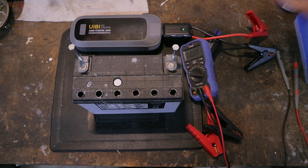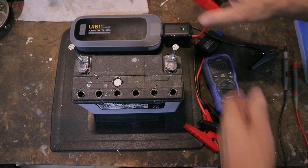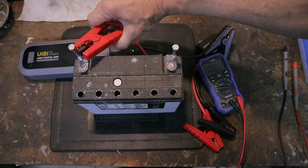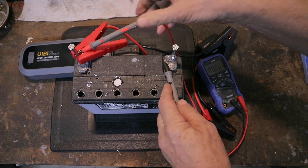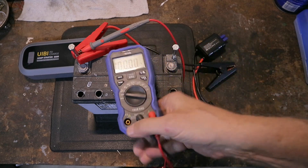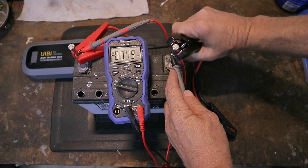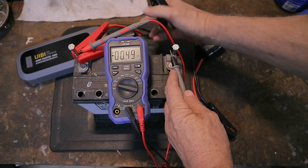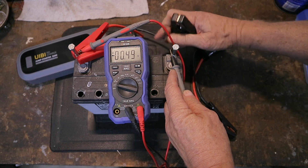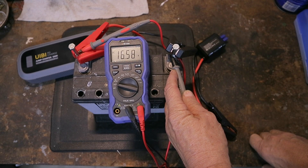It's flashing back and forth red and yellow - that tells us it's ready to go. I'm going to put the positive clamp on it, put the voltmeter in there, and now connect the negative up. Back here you can't see it, but that will click at least once and turn solid green, and I should get a lot more than 0.49 volts. And there we go - 16 and a half volts. That's what is supposed to happen.